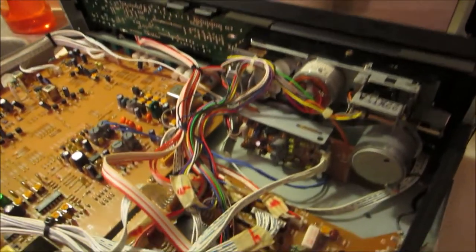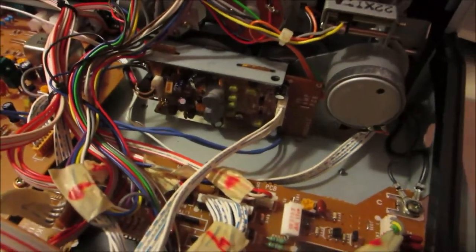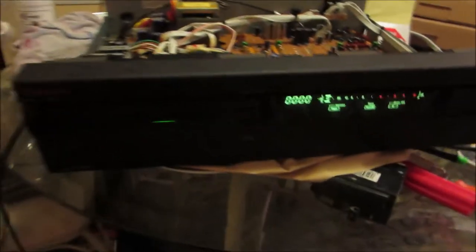We're gonna put back the other two screws and seal the bottom, then test it. We're going down to the last step, putting this plate back in. You always want to make sure you test the capstan to make sure everything is working properly. I can see everything's turning really well in there. I gotta watch these wires to make sure they don't get involved with the belt — I don't want them rubbing on the belt because it's gonna wear the belt very quickly.